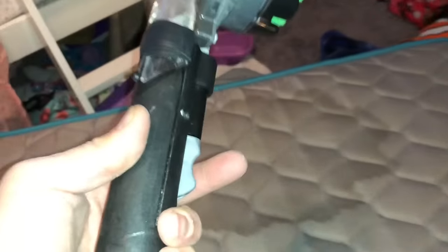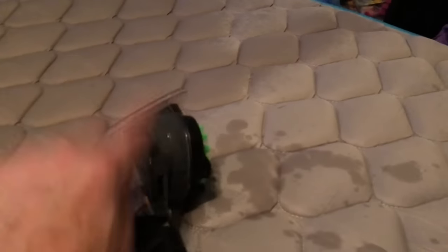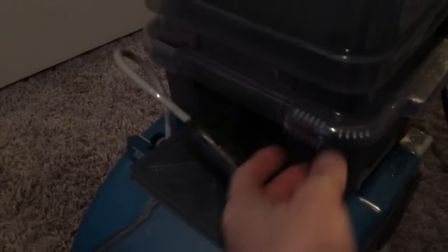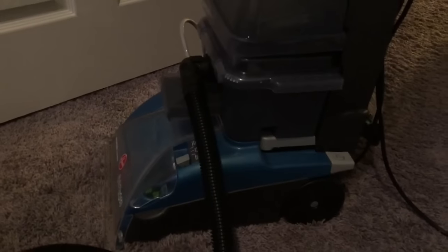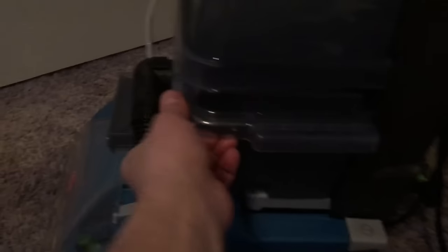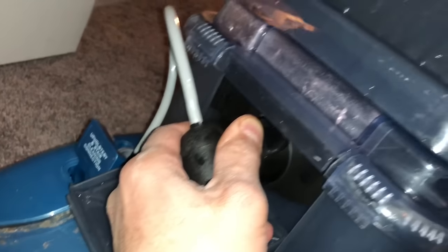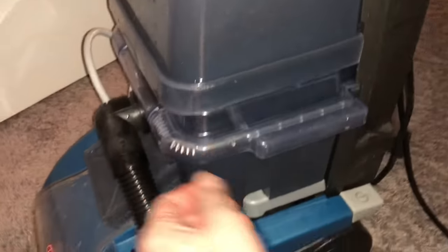We're going to turn it on. Push this button right here to spray water. I'm making a video on how to use this thing because I actually got stumped for about 10 seconds — my brush wasn't spinning, it wasn't sucking. It was spraying, but I wasn't getting suction because my dirty water tank was not snapped in place correctly. So make sure that's snapped in correctly — that could be a big issue. If the steam vac brush is spinning but it's not sucking, it's just that issue. Make sure this is pushed up all the way — if there's a gap it will not get suction correctly. Push this up, make sure it's locked in place and flushed, and that your rubber gasket is on. Let's get started.